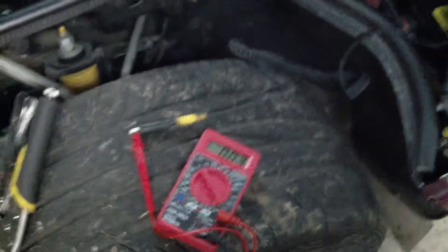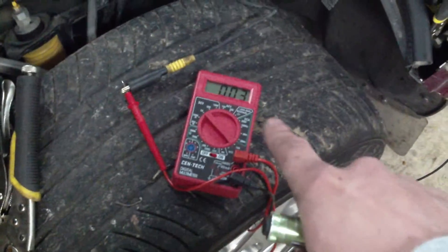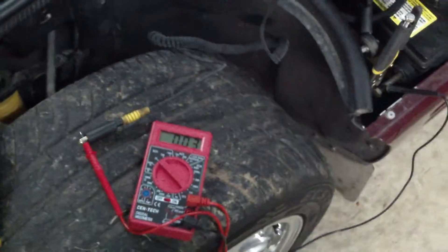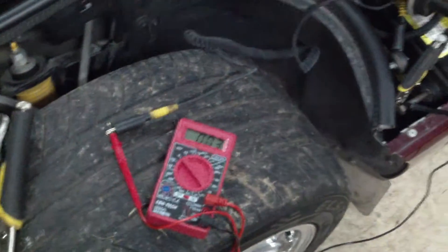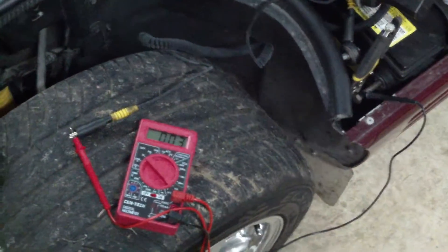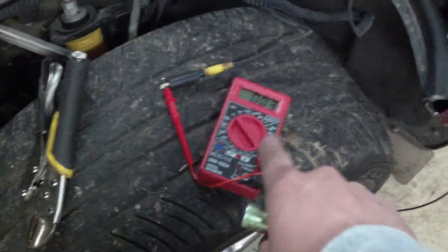This is kind of the old school method of doing it. Some guys used a test light back in the day, but I don't like the test light method — it's ridiculously old school and not accurate. Here's why: if you had a 60 milliamp draw, to fully light my incandescent test light takes 250 milliamps; another incandescent takes 150 milliamps. So you might get a really dim light, or it may not light at all. I've measured my test lights — 150 milliamps is a hell of a draw, and a 60 milliamp draw you may never see with a test light. This meter is seven bucks. Go get one.